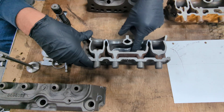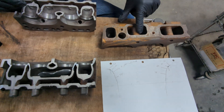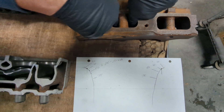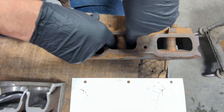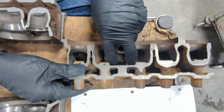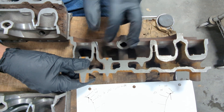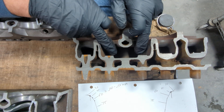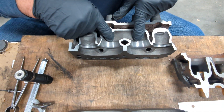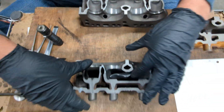Another thing we've done to modify this head is we've prepared it for the bolt-in lump. If we look at this intake manifold port, it's got the bolt boss — the bolt goes through to hold the head down, and your port feeds cylinder one and cylinder two around that boss. Behind the boss, the two ports join together and become one massive port. The airflow comes straight through trying to move fast, and it hits the back side of the port and slams into it, having a hard turbulent time curving back down into the valves and into the cylinder.